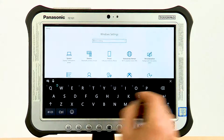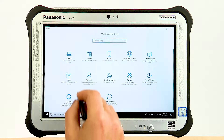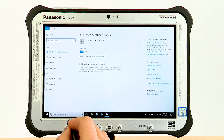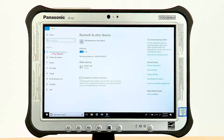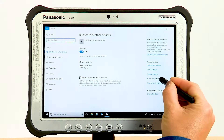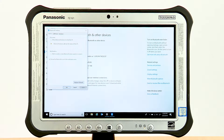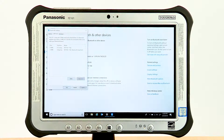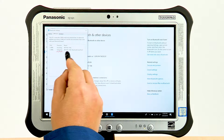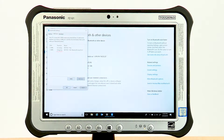From the start menu select Settings. Then in the settings window select Devices. From inside the devices window, be sure the Bluetooth and other device submenu is selected. Then scroll down to find the link called more Bluetooth options and click on it to open the Bluetooth settings window. Within the Bluetooth settings window, select the COM ports tab. Determine the COM port number that matches the paired reader and outgoing port direction. Make sure to remember this COM port number. This number will not change for this reader and it can be recorded for future use.